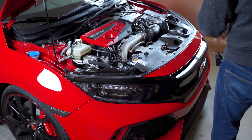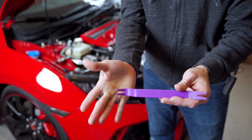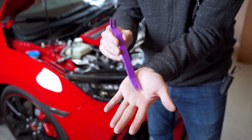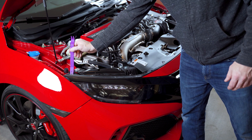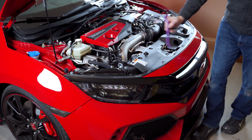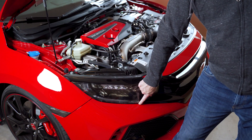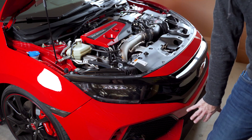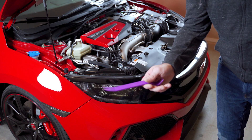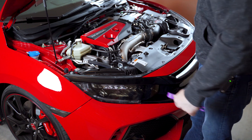To get these headlights on, we basically have to take all of this off — we have to take the front bumper off. You're going to need one of these little panel popper tools; I'll throw links below. This came with a panel popper kit. Basically we've got to go from here all the way down to the other side, then remove a couple up in here, a couple of little things down in the side marker, and then underneath the car there are more push pins and a couple of 10-millimeter bolts. Let's get started, working from left to right.